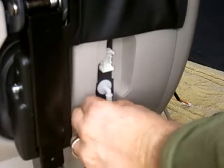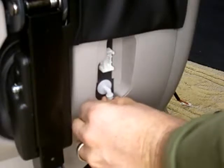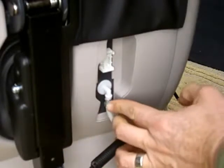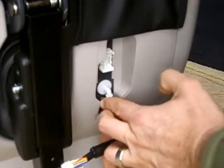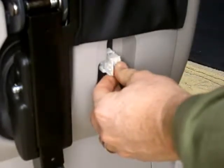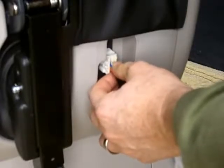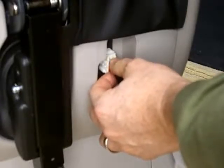Make sure you carefully work the chrome-colored air hose clamp up snug against the fitting that comes out of the main body of the chair, and then twist that clamp so that the pointy ends face inward. The electrical connector fits only one way, it requires very little force, and when you have it right, it clicks right into place.